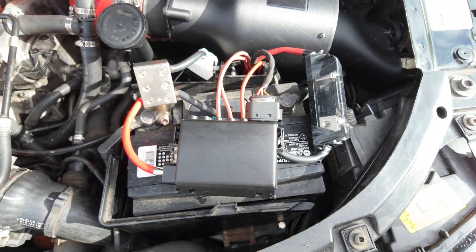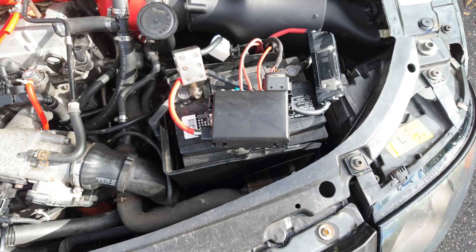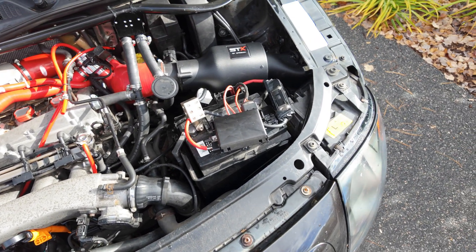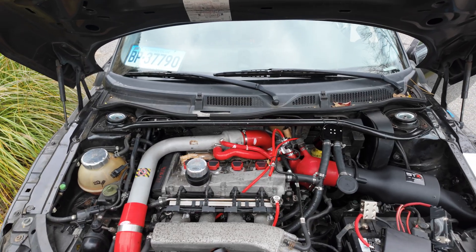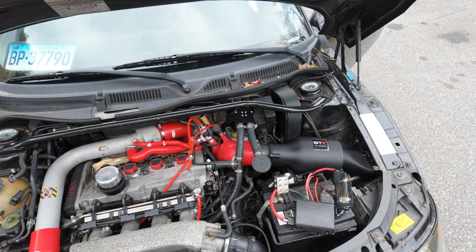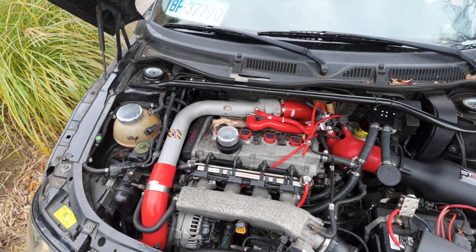We are back, and this little setup here is a little different. This is a fresh battery fuse box, and I'm hoping this is the final iteration of at least parts. I do want to mount up these wires in a better and more presentable way. One thing I did not get on video: as this was deteriorating and becoming horrible, I started to get a lot of running issues — flickering in the dash, the car would want to die at idle, and I was experiencing misfires under throttle and at idle as well. But all of that seems to be gone.